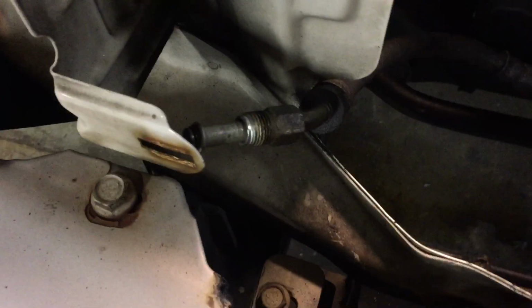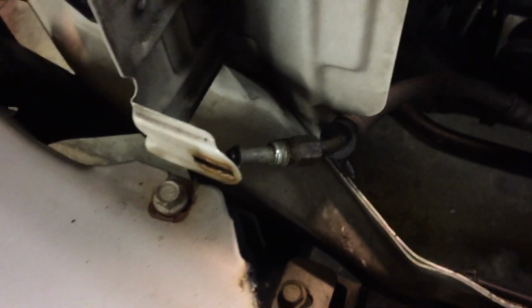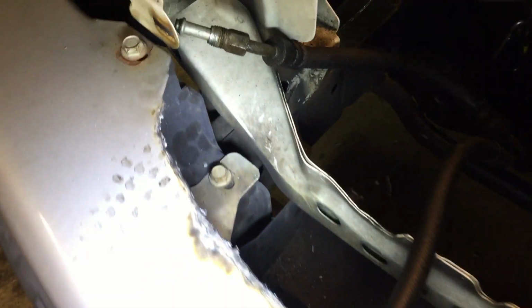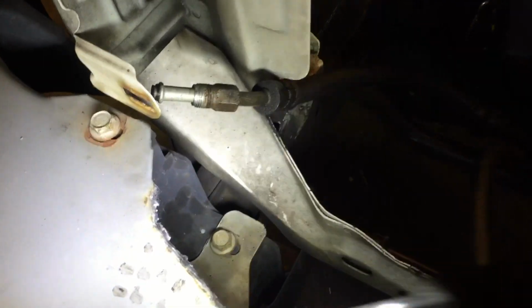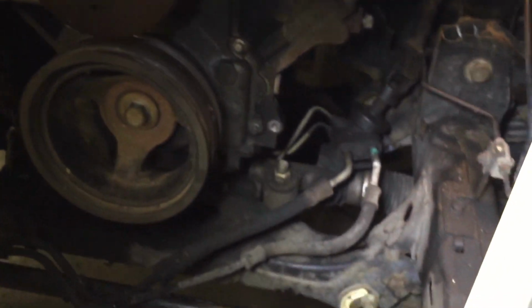That's engine and trans. And then I'm glad I unbolted this because I figured the power steering would bolt up. And I was talking to the guys about buying lines just on the Sloppy forum and some other Colorado guys. I'm like, hey, I'm probably just going to buy V8 Colorado lines. And they're like, well, just bend the stock ones, the stock 4-cylinder and 5-cylinder ones around. It has the same end, which it does. I cut the other end off and I just matched it up to this, and I was like, holy shit, I'll be fine. Because I think the other guys were 5-cylinder, so you never know.